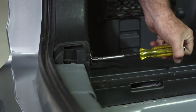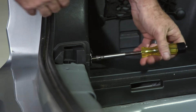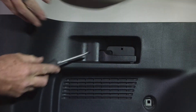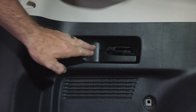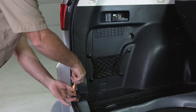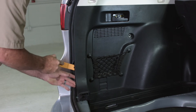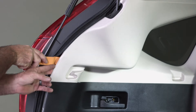There's another cargo anchor at the back of the vehicle that will require a 10-millimeter socket drive to loosen and pull out. There are two screws behind the back seat lever — expose those by pulling the little lid off, then use a Phillips screwdriver to unscrew them. Take a trim tool and pry away the lower panel, then the upper panel.